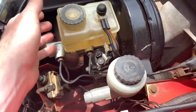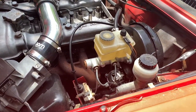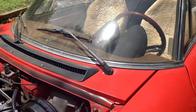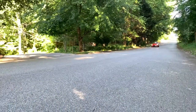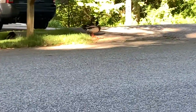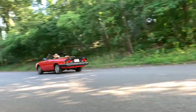All four corners have been bled. The brake master cylinder and the brake reservoir has been topped off with fluid and the brake pedal does not go down all the way when pressed, which is good. Now we have to do a test drive and see if everything is sealed up and nothing is leaking. There are no leaks and the car's braking feels very natural. It's time to go back to the shop to tidy up a few odds and ends. That front light is really bugging me. Thank you for watching and I'll see you again very soon.